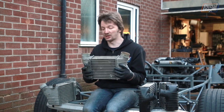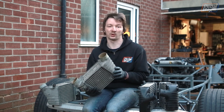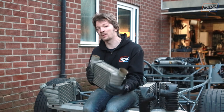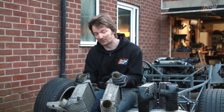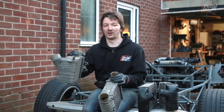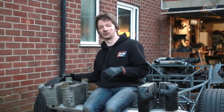On the right here are a pair of intercoolers that came out of the TT that we stole the engine and everything else from. These are obviously quite chunky and they're perfectly happy cooling all 225 horsepower worth of hot air that comes out of that turbo. However there are a couple of problems. The boost lines into and out of them aren't symmetric one side to the other, which means the brackets and mounts we build on one side we can't just copy and paste on the other. The bigger problem is they don't actually fit with boost pipes in the back of our car very well at all.